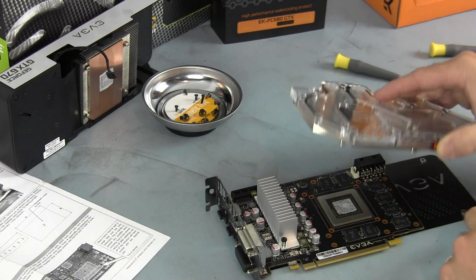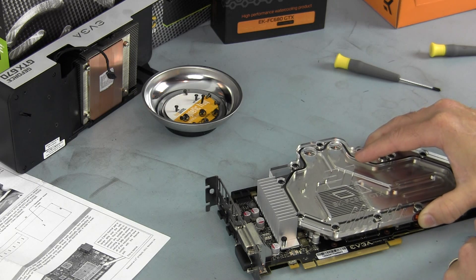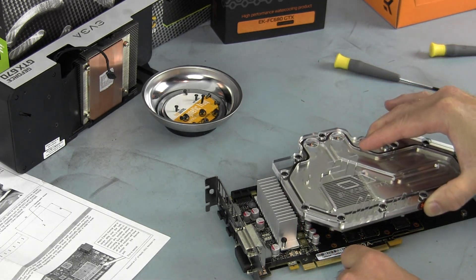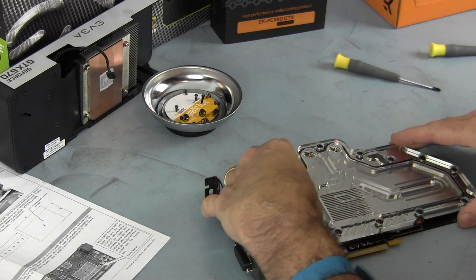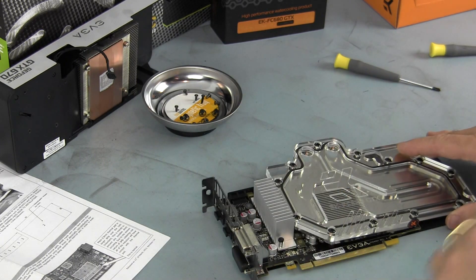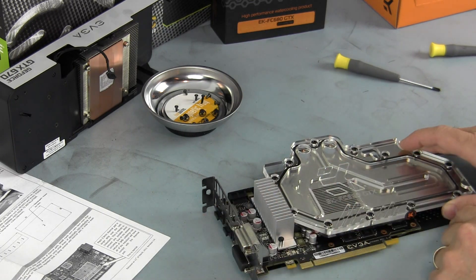It's not going to fit, guys. This will not work. I think what we have here is an interference fit with these chokes over here. Right now I'm trying to line up right over where the GPU would be and where the mounting points on the card are, and they just do not line up. I think there is a 670 card that is based on the 680 PCB reference — that is the one that would actually work. Looking at this right now, you've got the connectors on the top interfering.